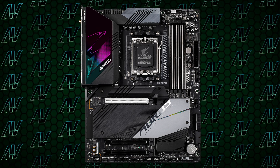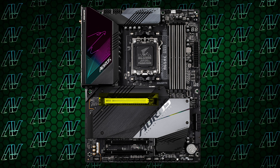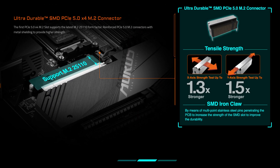When it comes to PCIe expansion, it also blows the competition out of the water. Since this is an Extreme variant, the main PCIe 16X slot is rated at Gen 5, which means that if you buy a Gen 5 graphics card, you'll be able to take full advantage of it — though Gen 5 graphics cards aren't out yet. Once again, Gigabyte continue to neglect the PCIe 1X slot, which is not present on this motherboard. Add to that space for four M.2 NVMe SSDs, with one being Gen 5 ready, and you have some pretty insane PCIe expansion.